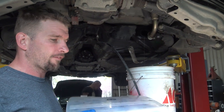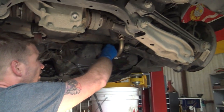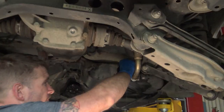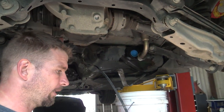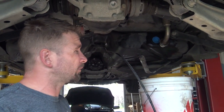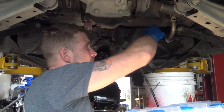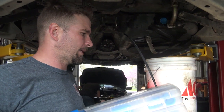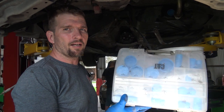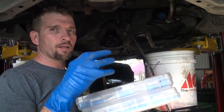I'm going to use my little cap kit that I bought from Caterpillar, see if I have a cap the appropriate size to plug the hole — like that — and hopefully not spill any more fuel. The only problem is the cap I just put in there doesn't fit really tightly, but it's probably tight enough just to get it out. This cap kit has saved my life, and there are some other manufacturers that make these. I want to find out — if you guys know anybody else that makes cap kits like this, these slip-in kits or caps that just kind of push on.